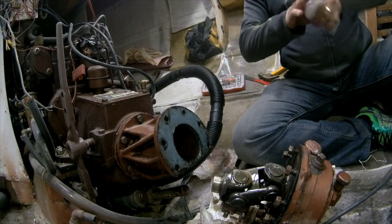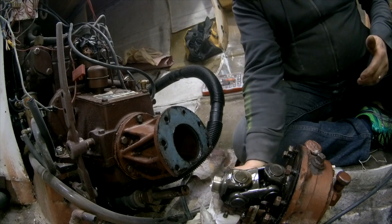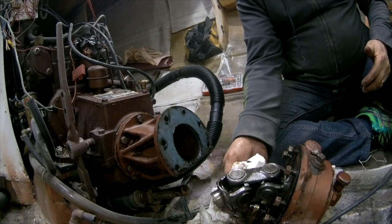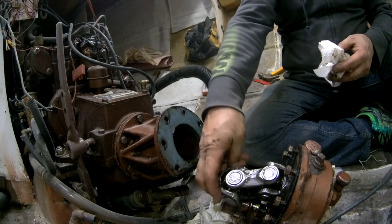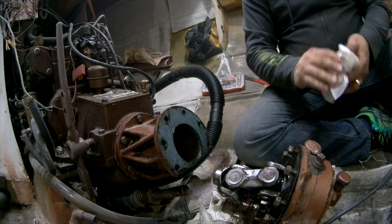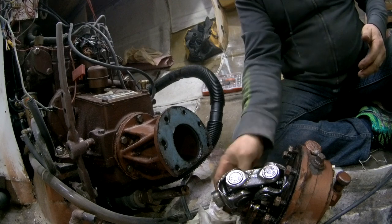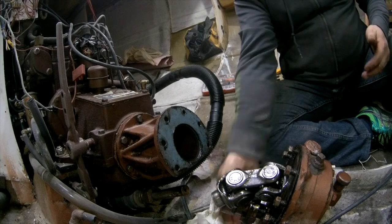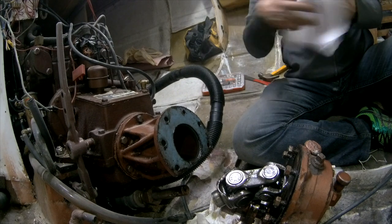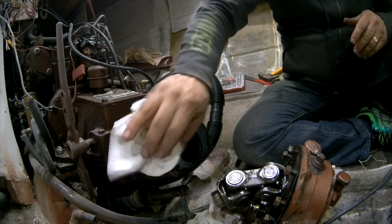So that's the V-drive — or what do they call it? Direct gear drive? I call it the V-drive because it goes backwards, but I think it's actually called the gear drive. Basically the engine's turning, it turns this here, and then that turns the prop. And it is full of oil, so I'm not going to move it — I'm just going to leave it here and grab a box to put it in so it doesn't lose any parts. So that's the V-drive off, dismantled.